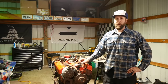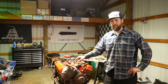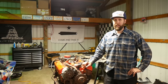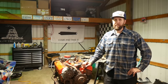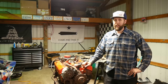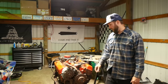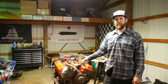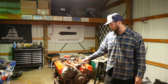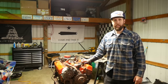The pure hate and disdain I've heard on 307s last month kind of makes a guy want to build one. So I'm going to tear this puppy down and see if it's actually worth fixing or if we're going to pass on it. All the 307 is is a 283 with a 327 crank — not a lot of cubes and not a lot of RPM. They usually fall flat about 4,500-4,800 RPM, but if this thing is worth rebuilding I got a couple ideas. Might give us about a 100 horse bolt-on. So let's jump in and tear everything down.